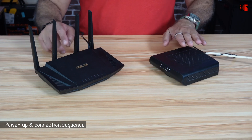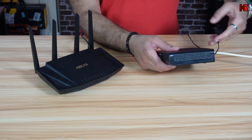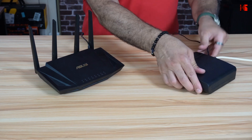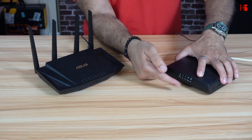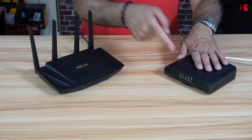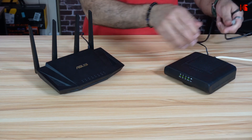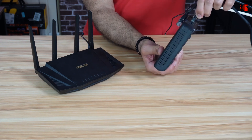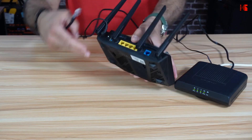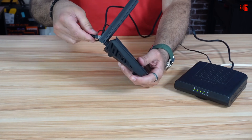The first thing you need to do is make sure that both the modem and the router are turned off. Then turn on the modem — my modem doesn't have an on/off button, so I'm just going to plug it into the power. When you plug in the modem, make sure the green lights light steady green; you need to give it a minute to do this. When the lights are steady, take an Ethernet cable, plug it into the Ethernet port on the back of the modem, then plug the other end into the WAN port of the router. The WAN port is usually blue and labeled WAN.